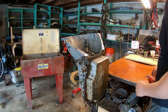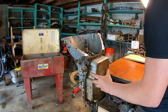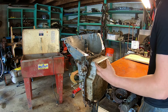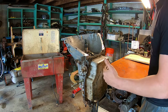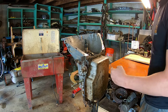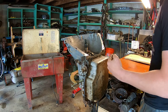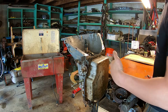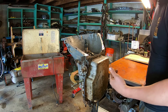This was a perfectly functioning Turbo 400. The reason I'm getting this thing apart and upgrading it is because I'm switching it to a 6.0 engine as opposed to that old tired 6.2 diesel. I'm going to rev it twice as high as it's ever been revved, and it's going to have at least double the amount of power coming through it. I want firm shifts throughout the RPM range, feel like it's a performance transmission, and not worry about it once it's in the truck. I'll get the pan off, all the external pieces off, then start tearing it down — I don't expect to find anything damaged, but just because it worked doesn't mean everything inside is perfect.